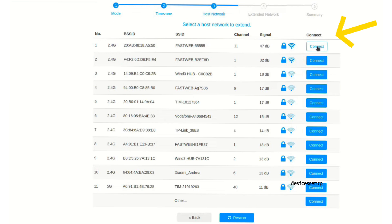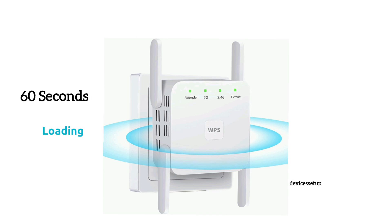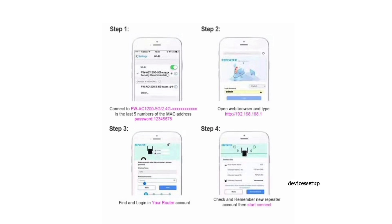There you will need to select your router's Wi-Fi name that you want to extend and type its password for confirmation, then hit Save Settings. It will take around 60 seconds for the extender to save settings, and then your extender network name will come up in your Wi-Fi list as your router's network name with a suffix at the end.